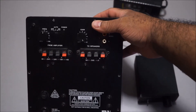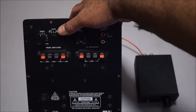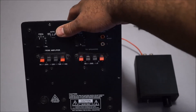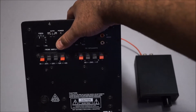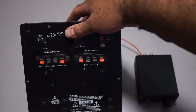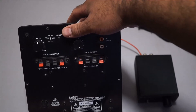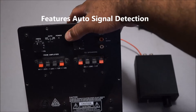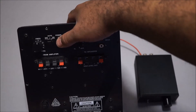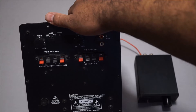You have so much control over your subwoofer — how it sounds and how you set it up. Right here you have the auto on/off switch. This is great if you don't like to physically turn the subwoofer on and off every time. You set this to auto and it will cut on and off based on signal detection. If you're watching a movie and there's a low-frequency signal, it automatically cuts on. When there's no signal, it automatically cuts off. If you set it to on, it stays on; set to off, it stays off; on auto, it handles itself.